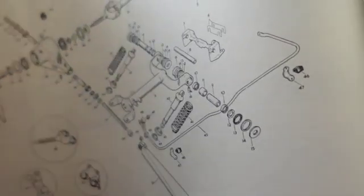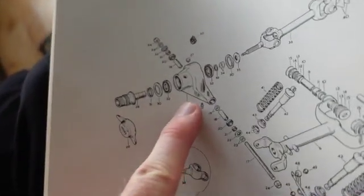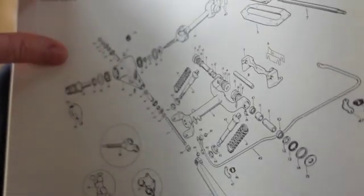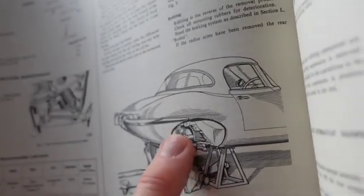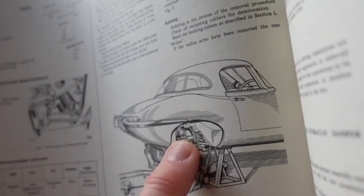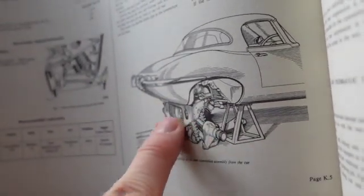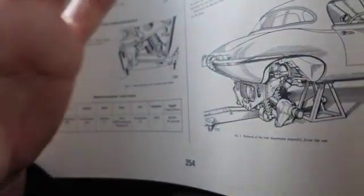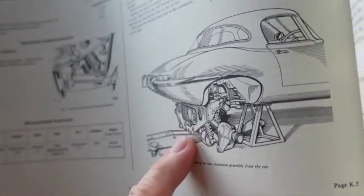There are 4 shocks in the back, 2 on each side. And this is interesting. If you want to do some work on this, you got to take it apart. Some of the bolts are there, but you can't get to them. And it's just fun. I'll try to crawl under and show you what I did to a certain degree. But if the emergency brake pads go, and mine were shot, I think they were dragging in some way. They were maladjusted, and you got to take the whole back of the car out of it to get to the little tiny pads. And then there are the larger pads, of course, for the disc, and they are right next to the hog head, and they're kind of hard to bleed and hard to deal with. But it's Jaguar. But interesting times there.